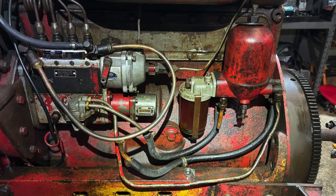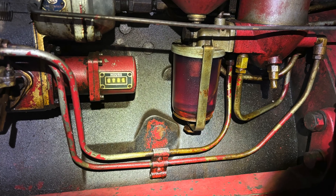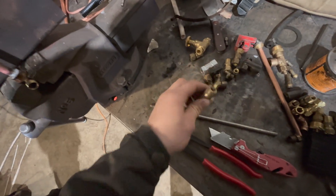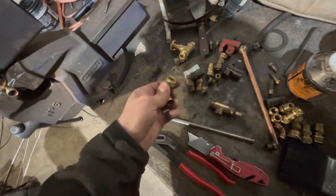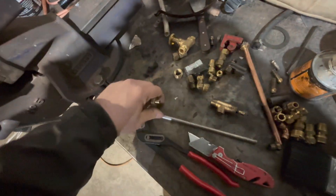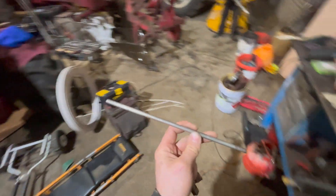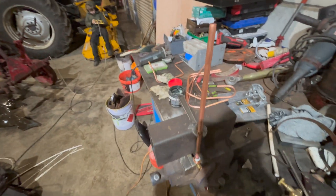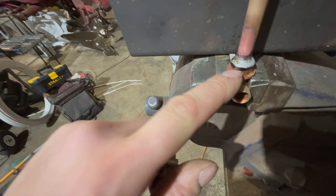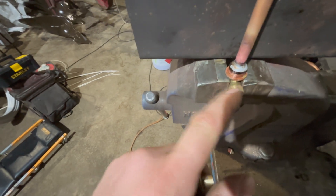In these next few clips we're going to be getting rid of the steel corroded fuel pipes and rubber bits, and we'll be doing it in copper. Struggling with these diesel pipes to and from the tank, so I'm going to do them in 10mm copper tube. I think one was the tap and one was the return — it doesn't have a breather pipe in it for some reason. That's the breather pipe from the filler hole that was laid in the bottom of the tank. In the end I've just gone with some 10mm copper tube, soldered into a 3/8 fitting with a 10mm compression elbow.